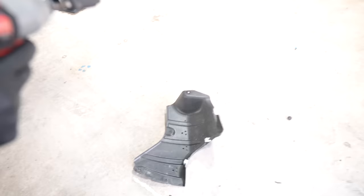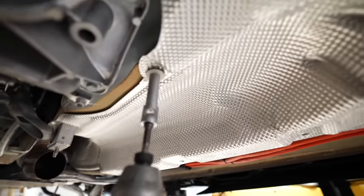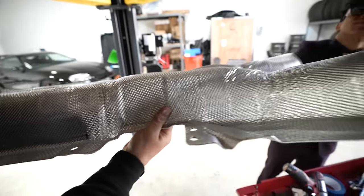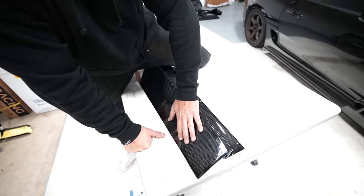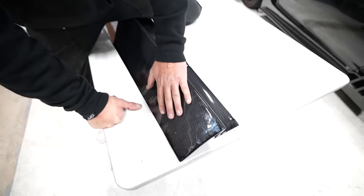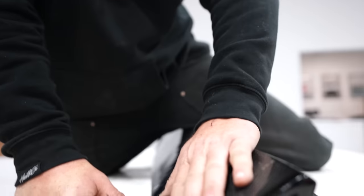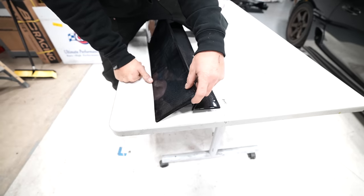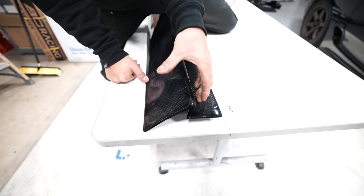Oh yeah, we don't need that. The drive shaft probably has to come out in order for us to... Yes. I don't like aluminum drive shafts. This was made for a fiberglass mold, so they tried it with carbon fiber. It worked out great. Unfortunately, this angle of the underside mounting point of the side skirt is a little too downward from the chassis, and because it's molded here, I can't flex it up. So what I'm gonna do is trim this section out so I can hopefully get some flex without cracking all the clear coat and the resin and all that.